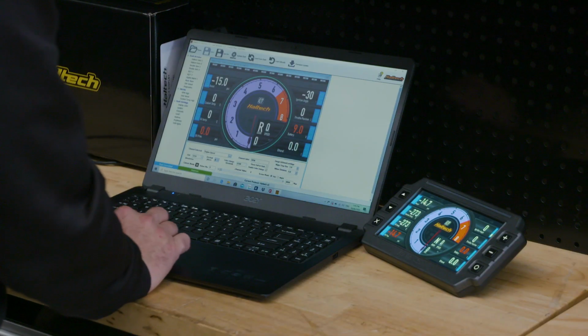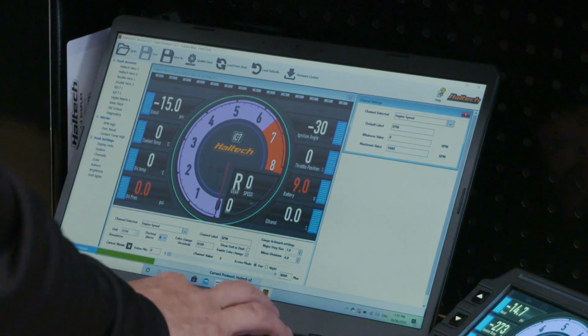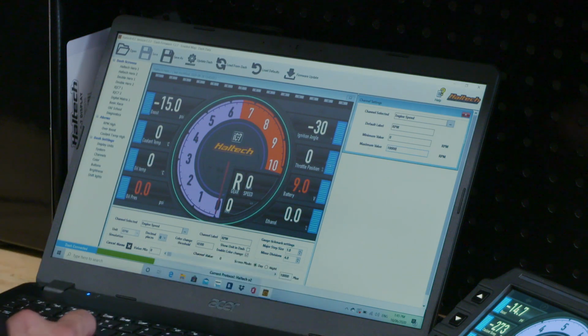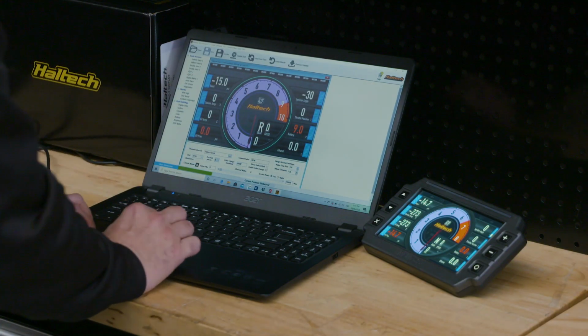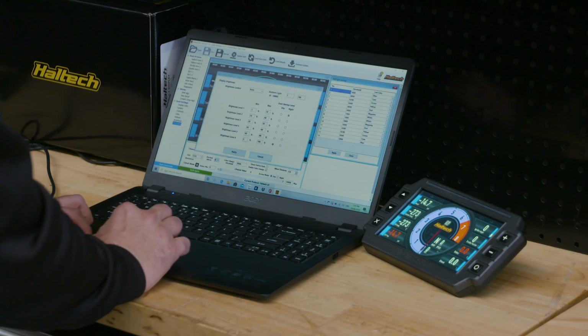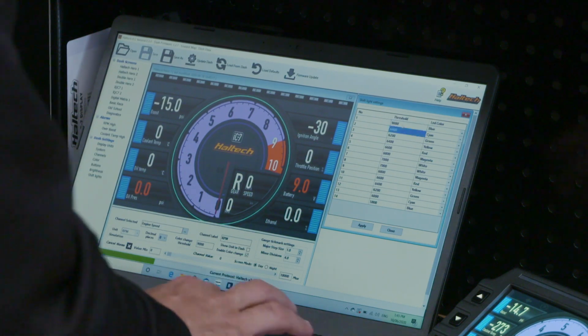All right, let's do some stuff that the GT-R needs. 8,000 RPM. Pfft. That must be for all those weird 2J and Barra people. Let's do it like a real GT-R, 10,000 RPM. Change the start of the arc to 9,000. 9,000 red arc, 10,000 limit. That's where we want it. All right, let's have a look now. Let's get some shift lights going because you can actually run through. So I want to start at 9,000.